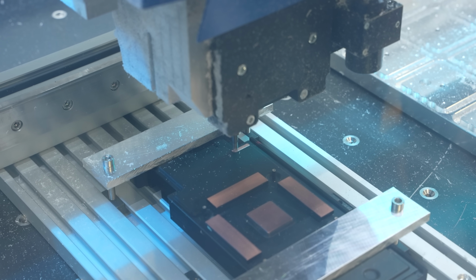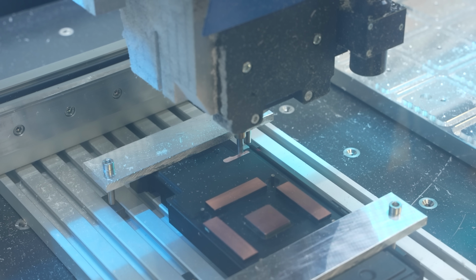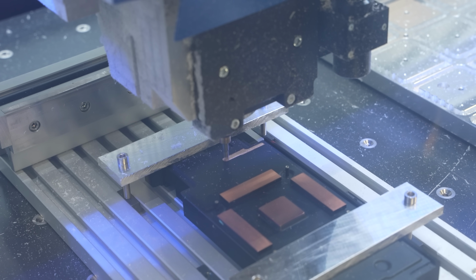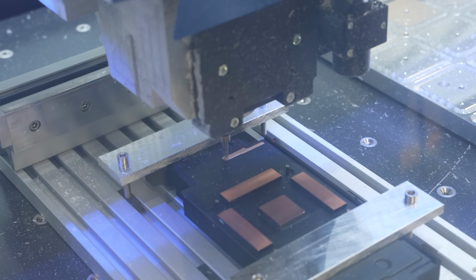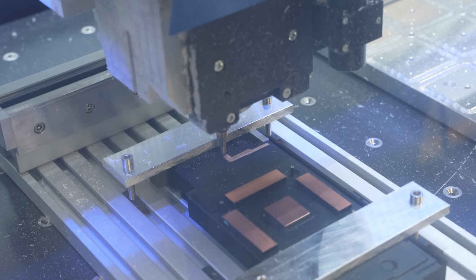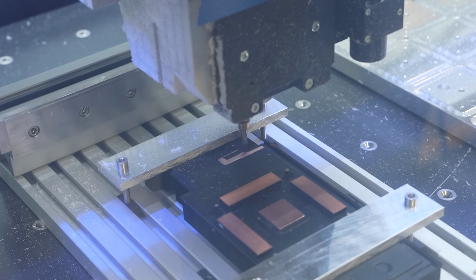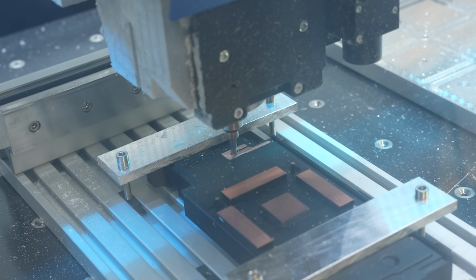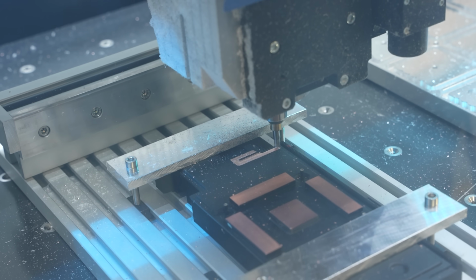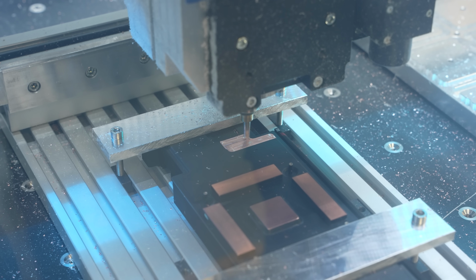At Grizzly, we have our Datron M8 Cube milling machine, and we equipped it with a 6mm end mill. In manual mode, we carefully cut inside the vapor chamber. At this time, honestly, I had no idea how it would look internally. I just knew from measurements that the vapor chamber has a total thickness of 3.0mm, and my estimate was that the material thickness of each side should be somewhere between 0.5 and maybe 1mm.